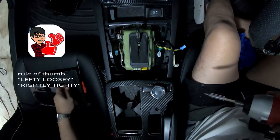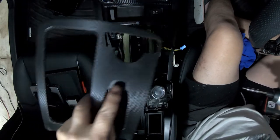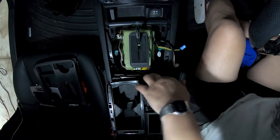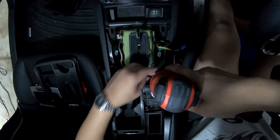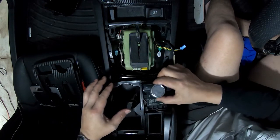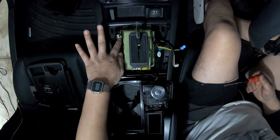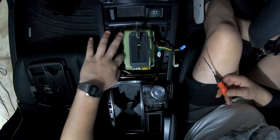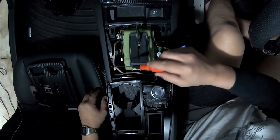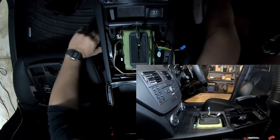Set that aside, don't lose anything. You have to remove the screw here in order to remove this piece. Then you've got another T20 Torx bit right here as well — take that off. Now it's free, but in order to remove it we still need to disconnect this plug. Mine has already been rerouted. To remove this cable from the clip underneath, you have to get in from the side compartment and pull back these carpets.